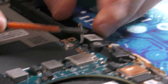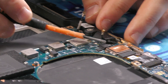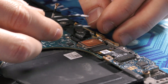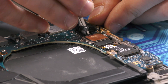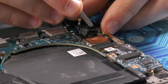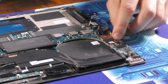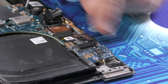The white connector is much more difficult because of a small clip — you'll first need to slightly pop it off and then de-thread it from that clip. While we're here, we'll disconnect the speaker connector as well, hidden underneath a little bit of adhesive. Simply pull it straight away, although the cable might be a little buried in the board.